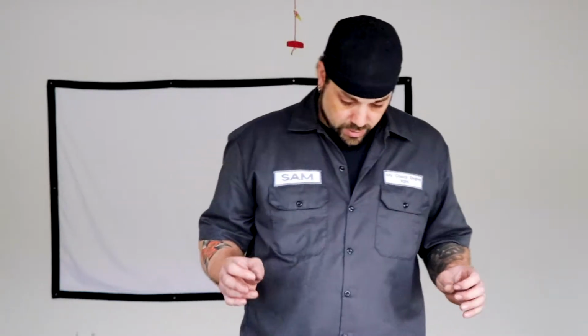Here's where we get into some complicated problems. And I'm sure if you've done this for any length of time or ever tried to chase an electrical problem on your own, you've done things like this and gotten that reading, and it says in the diagnostic flow chart or anywhere that you read about electrical diag that if you're at, say, 5 ohms or less, you're good. That circuit's working fine. You don't have to worry about that. That's not true, and that's one of the things that I'm here to show you.